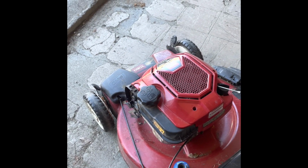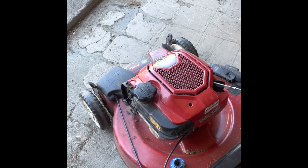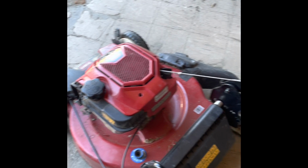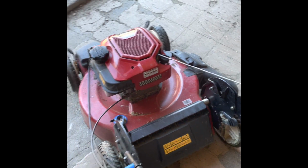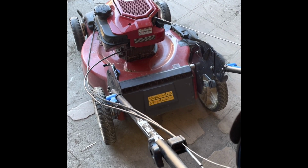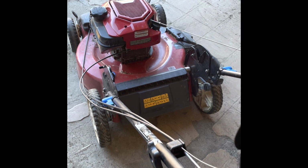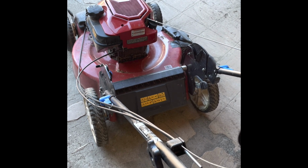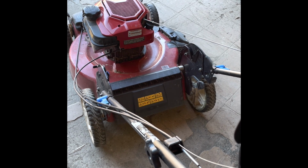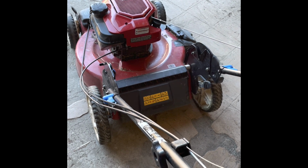Yeah, I can tell by the way this thing sounds, it's been abused. That sure sounds like the crankshaft's bent. It's got a vibration to it. It should be smooth. This mower will work. You know, the guy might have to wear some leather gloves to knock down the vibration, but it'll mow grass. It's just, it'll eat itself up eventually.